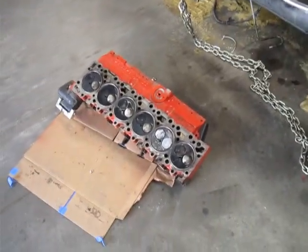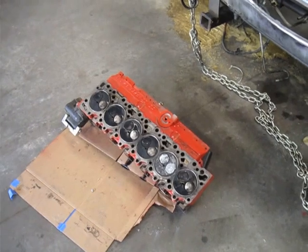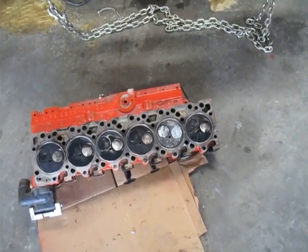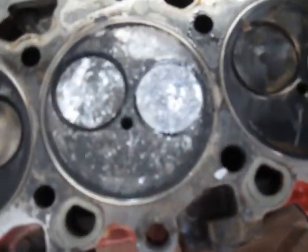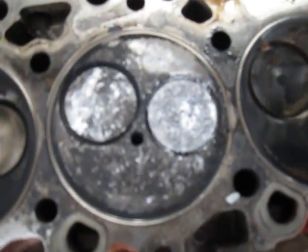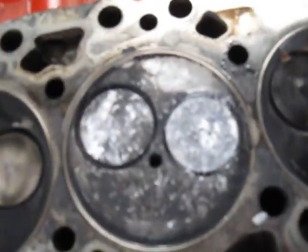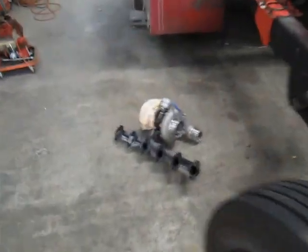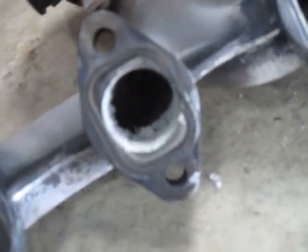I'll go through what happened to it. I'm not exactly sure what happened to cause it, but I think when they built this motor they milled the head down a little too far and the valves seem to have been contacting the pistons. If you look on the head here you can see that this cylinder has aluminum caked to the valves and the exhaust runner is full of aluminum. Here's the exhaust manifold and the turbocharger off of it — you can see the aluminum in the manifold, and it's also got my fat shaft turbo locked up from all the aluminum in it.